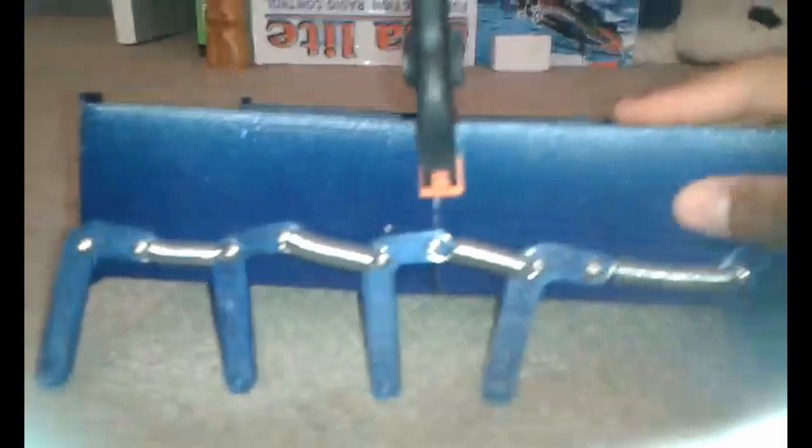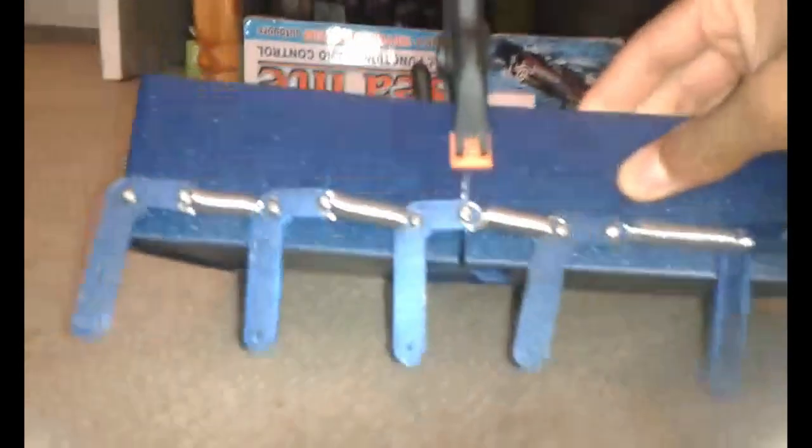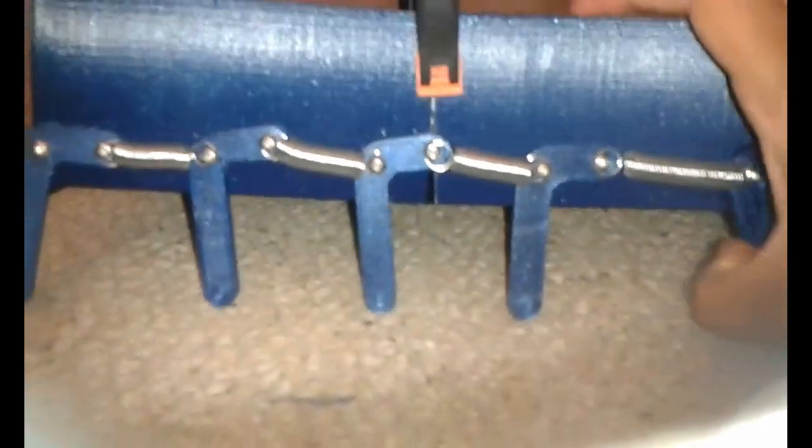That is the suspension so far. I've got it on a Christie-style suspension where each arm has got its own suspension piece, but it's actually connected to a U-joint so you can see what I mean. I've not got any wheels on it but you can see how that will work. The only con I can see so far is if there's no actual weight, instead of the arms being at an angle they actually go vertical — so I have to actually load them all on, but once it's on the ground with all the weight of the batteries it should be fine.